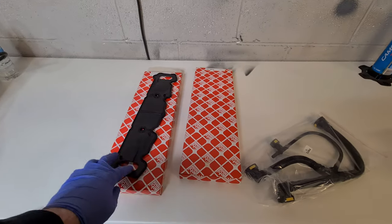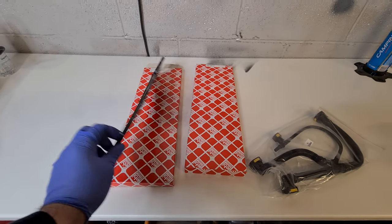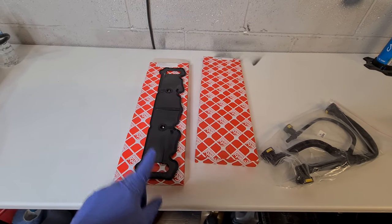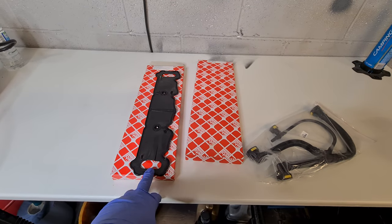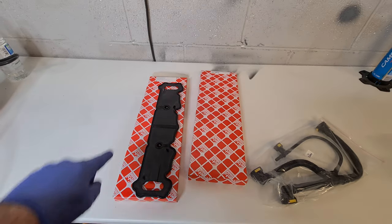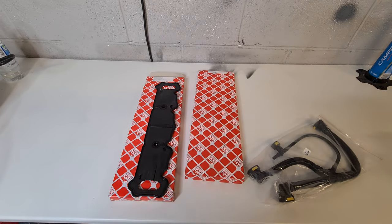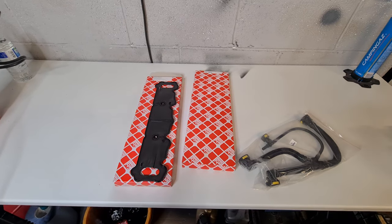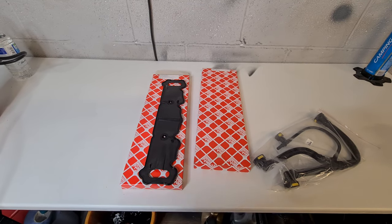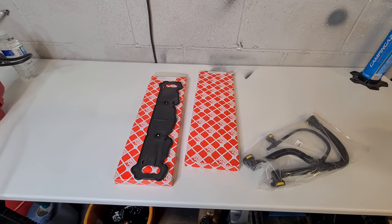So these are the rocker gaskets. There are two types. There's one without this middle section in. I can't remember what this is called. It might be called a rocker or oil plate. I can't remember off the top of my head, but it goes off engine number. So it'll tell you if your engine's up to this number, you use the one where it's just the normal standard looking gasket with no innard. And if you go past that number, then you have to use this one. The engine number you'll find on your V5, pretty straightforward. I think it's a 7-digit code, and just make sure you double check which one it is, because most parts sites do list both of them and it's down to you to pick the correct one.